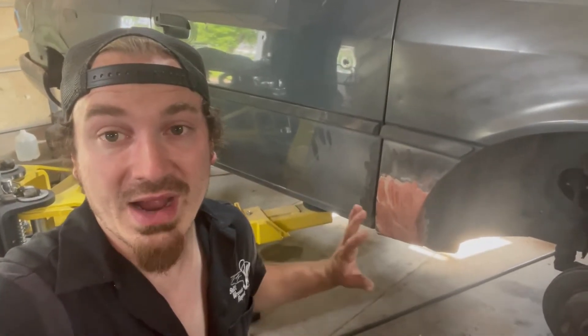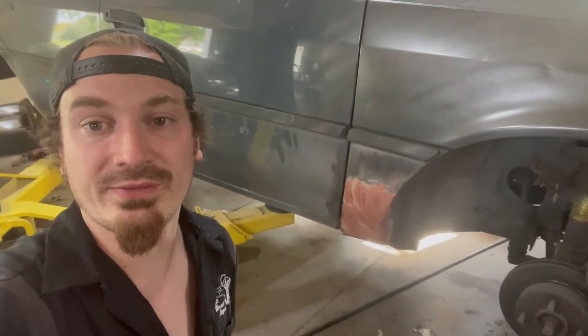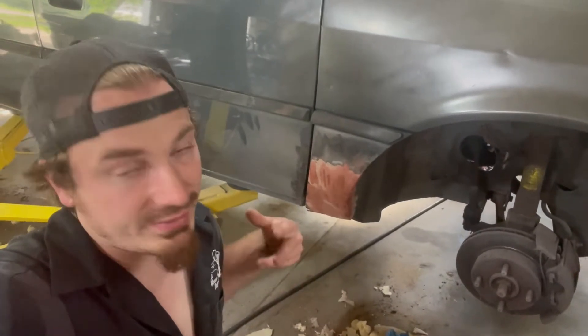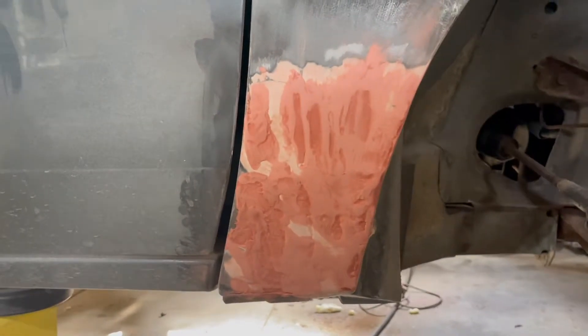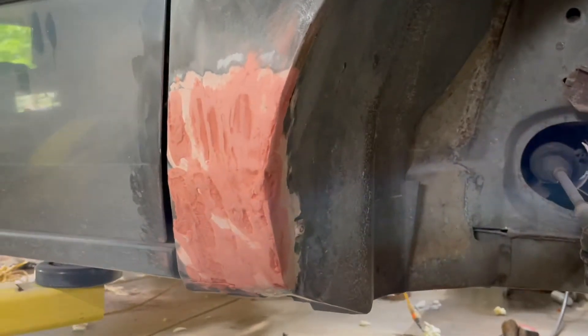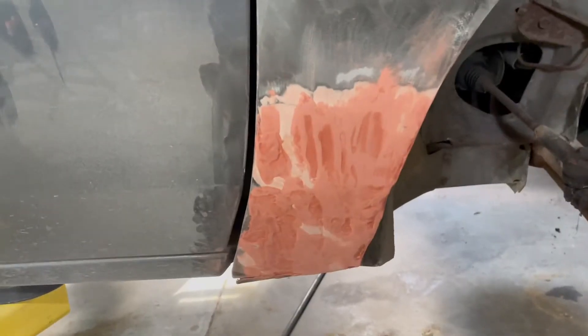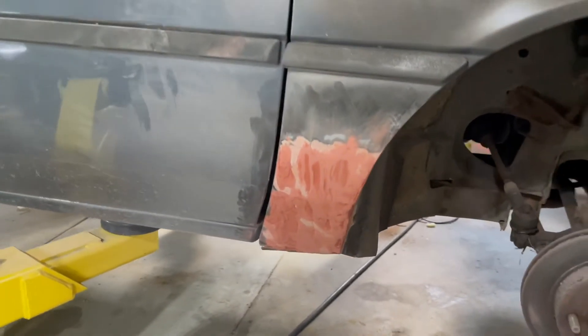The hole was as big as that black area right there. I'm just checking for low spots — it actually looks pretty darn good. You can see I still got some work to do with the high and low spots visible on camera, but that's just primer. The really crazy part is going to be the front fender — this had a massive gaping hole in it as well, so we did the exact same thing, shaped it with our spray foam, and right now we got a little bit of glazing putty on there just to get our final shape.